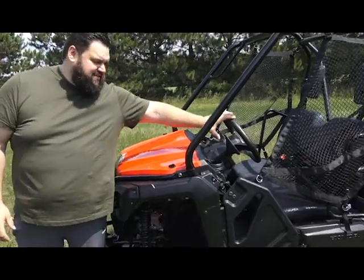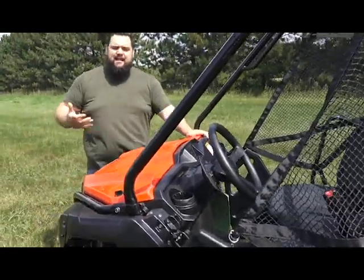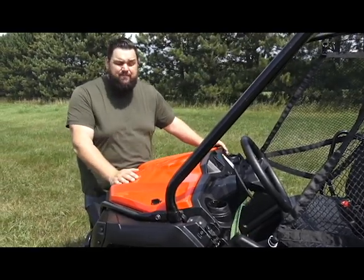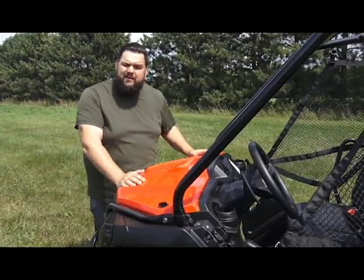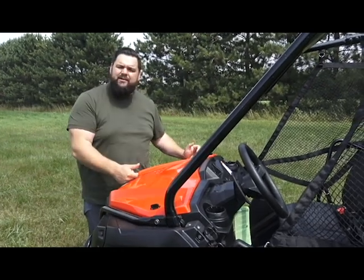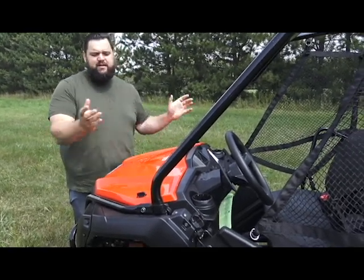And if we look here in the steering — that's right — paddle shifts. This has the automatic transmission, automotive style, that we find in their Honda ATV lineup. So we could select our gears. The other thing too is there are no wear items. On a traditional ATV or side-by-side — pretty much anything else on the market — we have a belt and we have clutches. The belt is a sure thing to need replacement, and with high mileage your clutches are also going to be something you'll need to service or replace. With an automatic transmission like this, we're going to keep low maintenance and high fun. I can stay in the gear I want, I can pick the torque I need, and really make the machine a ton of fun.